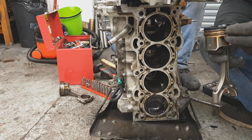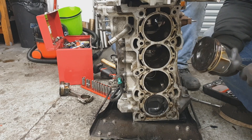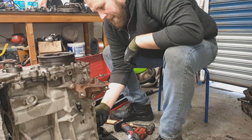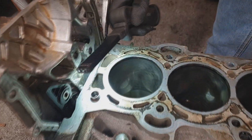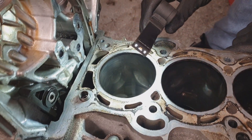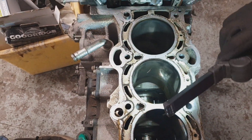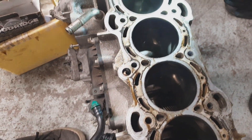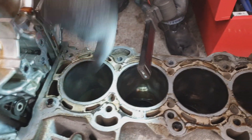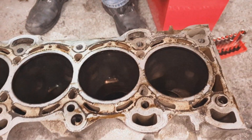How is piston number 3? Not so happy. I don't think that detritus comes from piston 3. I can still see cross-hatch mate - it looks alright, it's just that one pickup bit. There's some scoring in there - that'll be scoring from where the debris was travelling. Scoring like that in all the cylinders. It needs an expert to really dictate but my understanding is what you're looking for is indentations you can feel, and this is smooth as silk. Hopefully it'll go to a nice builder who'll make a nice powerful one.